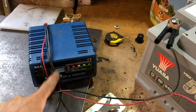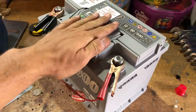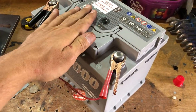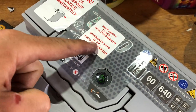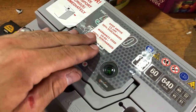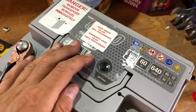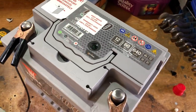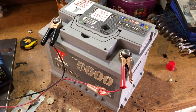I've just stuck the new battery onto a trickle charger quickly to fill it up those extra couple of amps because they don't fully charge these from the factory and they don't hold charge while sitting. This is the reason I'm replacing the old one - as soon as it gets below 10.6 volts it's basically 100% discharged and the battery is knackered. That's why you don't get a warranty when it's below that voltage. If you're not going to use a car for a while, keep it on a trickle charger or you'll kill the battery.